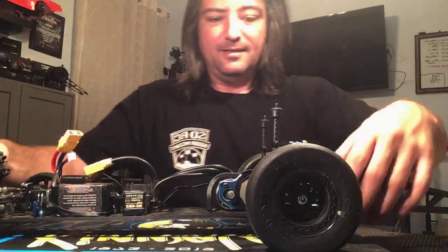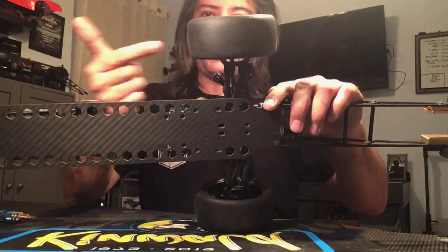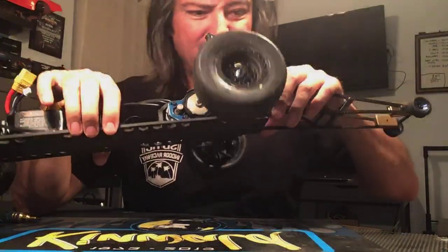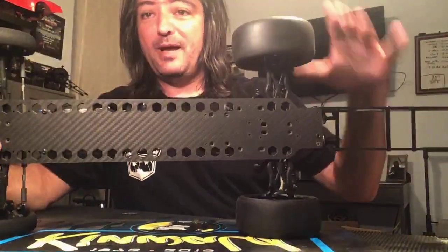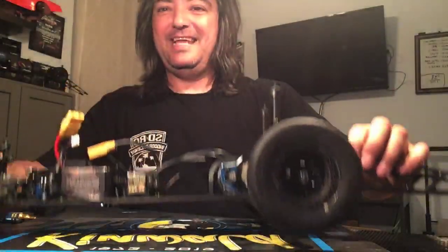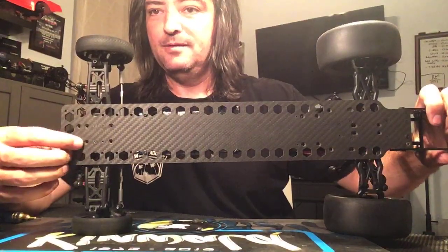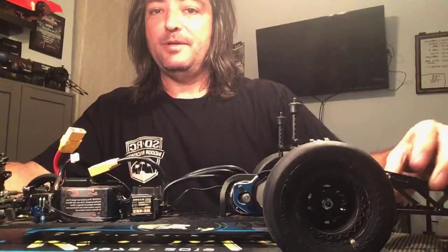One other thing I might have forgot on the back side of it: when you run these spacers on the arms, top and bottom, I'm running the tires back as far as I can get. So any spacer required on the arm, put it on the front side so it moves the arm back. And any spacers required on the hub, I have the hub spacers all the way back also. So it gives you the longest wheelbase possible. When you do it that way, your drive line is really straight. There's not a lot of angle on the drive line. With the kit, the arms, or the drive lines, can be kind of angled forward a little bit. So back as far as you can, this screw pattern, and you'll have a 13.5 inch car almost exactly. I think it's within a 16th, so right on the limit of being legal.